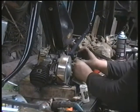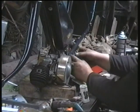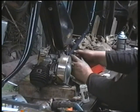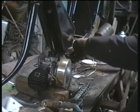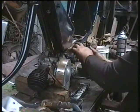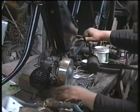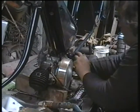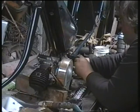The other cup is screwed into place, again being careful not to lose the ball bearings, and any end float is taken up. With the axle rotating freely and no end float, the lock ring is tightened up. And just for looks, I'll bung the pedal cranks on.